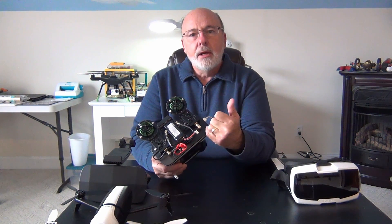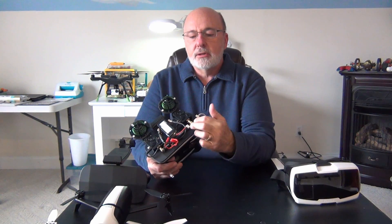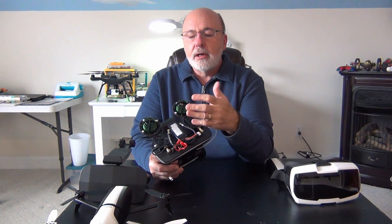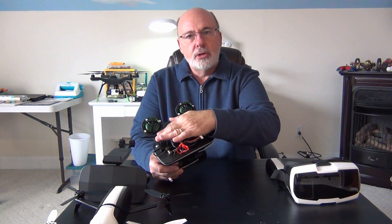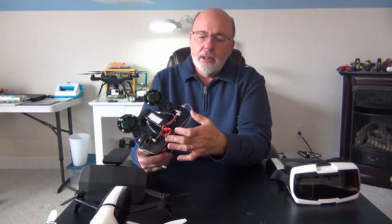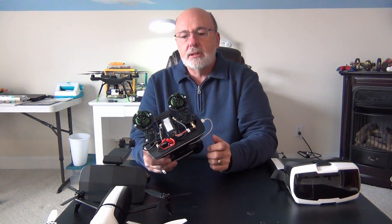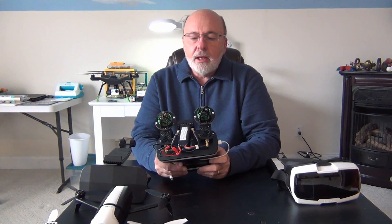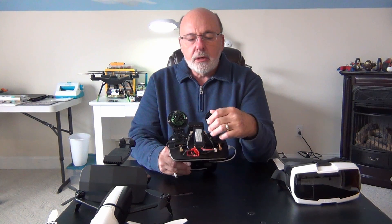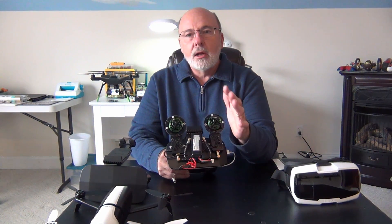Basically, if you open this up you're going to see four ceramic Wi-Fi antennas — one here, one here, one here, one here. What I've done is remove the top two. As you can see, my amplifiers are up in that general area. The bottom two still have pretty good access to extending out, and I have them coming out right here.